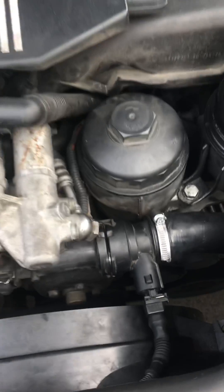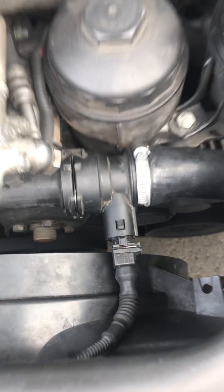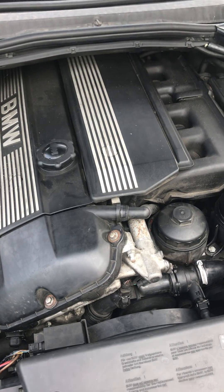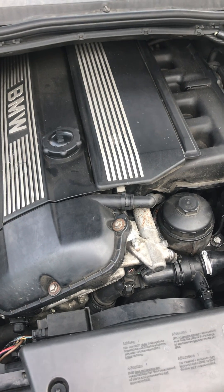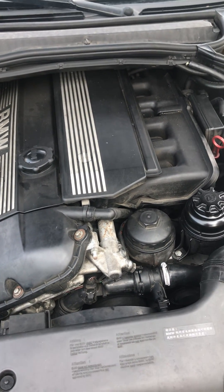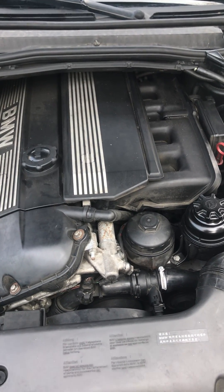This is an absolutely low-cost solution. You can find a coupler at a junkyard from the lower radiator hose, simply splice a wire, and get an extra connector plug. From the factory, the fan turns on at 100 degrees and turns off around 97-98 degrees. Now it turns on at about 86 degrees and turns off around 77-78 degrees. It's essentially free and you don't need to reprogram the computer to do this.